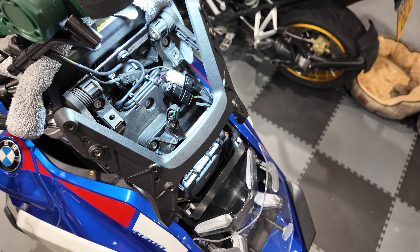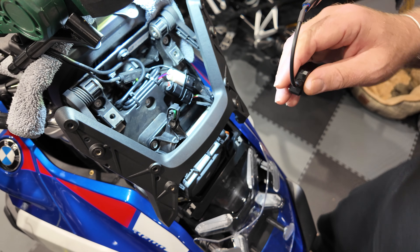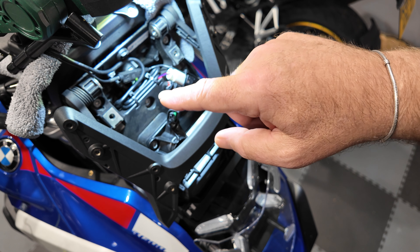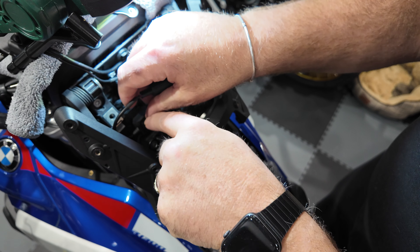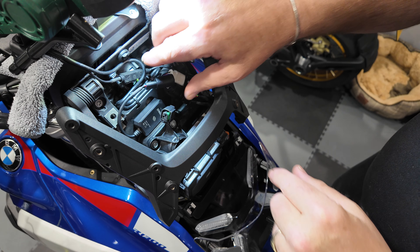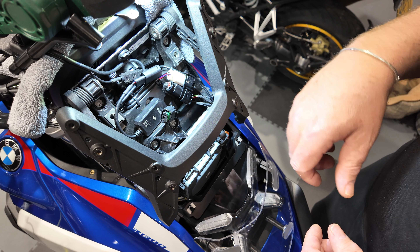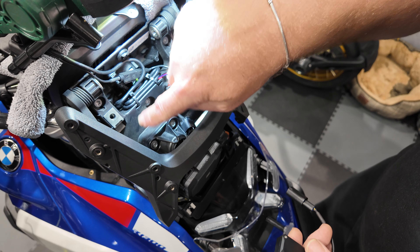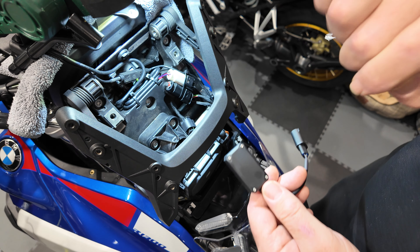Let's have a look at placement for the CGRC LIN. The area here looks really obvious — there's plenty of clearance, nothing going to catch it when the cowlings are on, and quite a big void behind that area. So with the supplied 3M adhesive we'll mount it somewhere there, swoop the cable under, and tie-wrap the cable at the top to hold it neat. We'll clean it up with some alcohol rub and apply the supplied 3M sticker onto the back of the CGRC LIN.